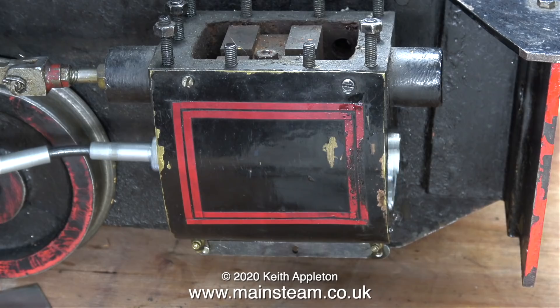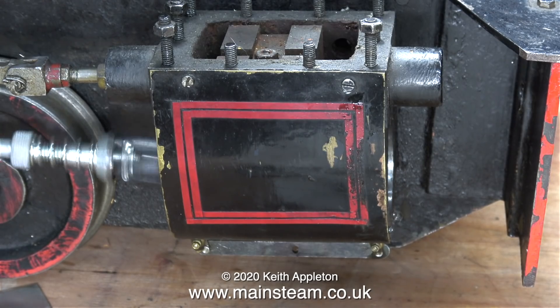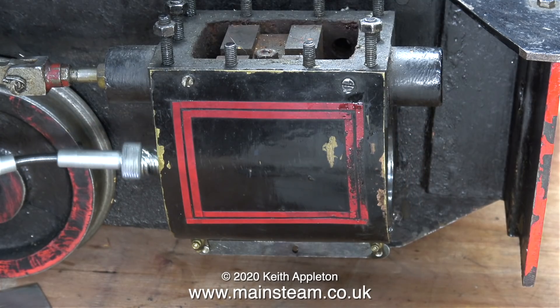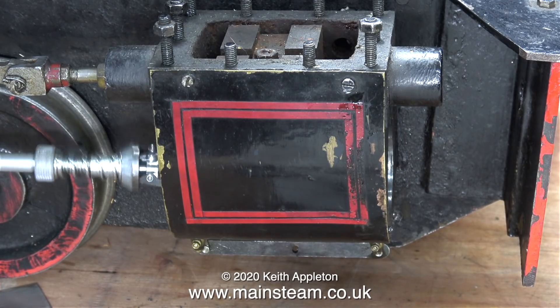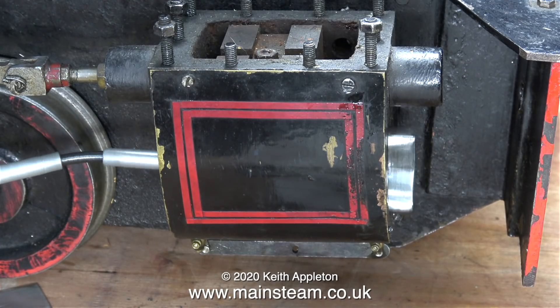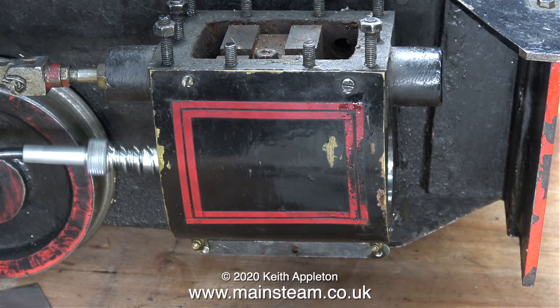Here's a different angle. It's very important not to push the hone all the way through — the stones need to finish at each end of the cylinder. Here, for the purpose of the video only, I'm pushing the hone too far through, and if I carry on doing this for a prolonged period the front part of the cylinder bore will become bell-mouthed. Make sure you keep the stones in the cylinder. This really is not a wondrous piece of engineering, and to the experts I do apologise, but it's doing the job.